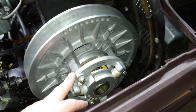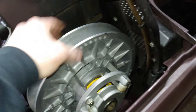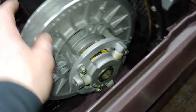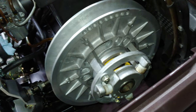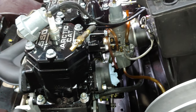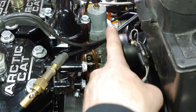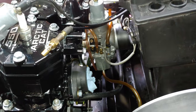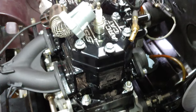I'm finally doing that, so let me show you guys the progress. I ended up cleaning up the secondary - turned out amazing, pretty happy about that. This thing was actually locked up when I took it apart. I had to bang it off the sled itself, then once I got it off, cleaned up the shaft really nicely - it was all rusted. Took this apart but it didn't even want to move, so I had to work that loose. Got it all cleaned up, put back together, ready to go. I got the engine mounted, got the carburetors cleaned up and filled with fuel.